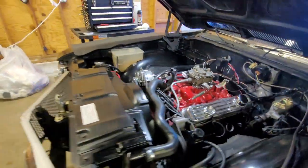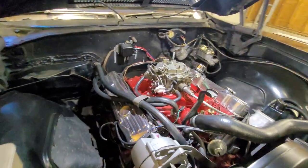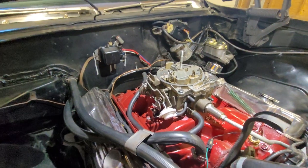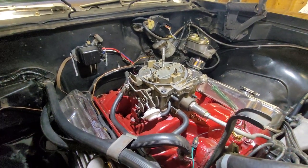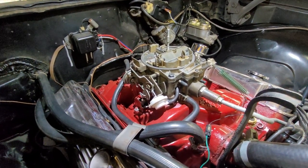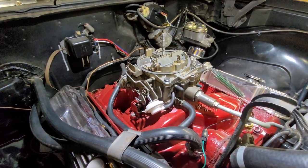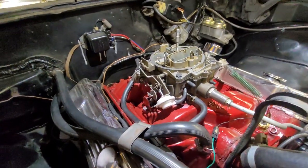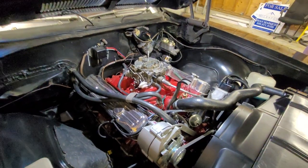And that's that. So you got an idea what I'm talking about. You noticed, like I said earlier, the intake wasn't warmed up yet. So even when I kicked it down to low idle, if I stab that throttle bracket again, it's going to go back up to the second step. And eventually, like I said, that comes down and your fast idle cam is on its lowest step. Okie doke.